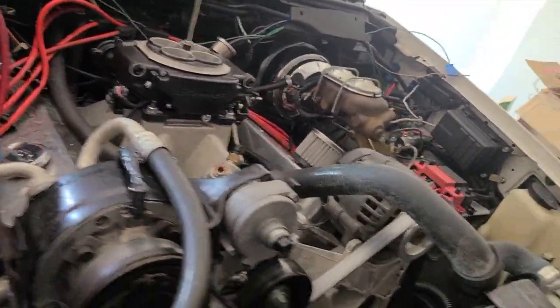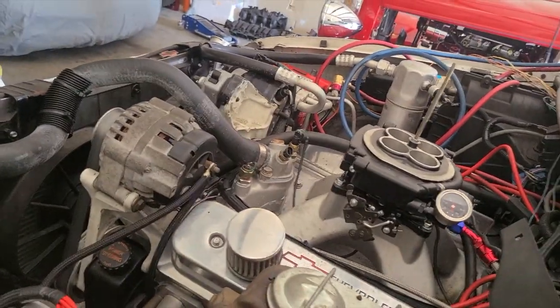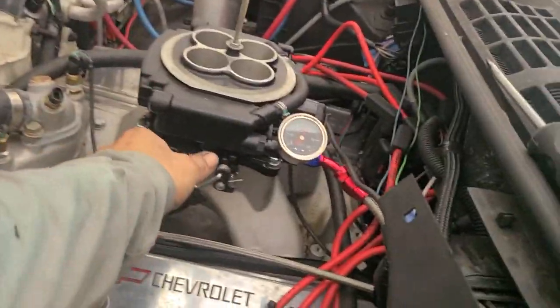This noise on this side is hard to tell if it's a loose rocker, or if it's just that exhaust leak. Exhaust leaks are a nightmare. I don't hear anything if I put a screwdriver to the valve cover and put my ear on it. I don't necessarily hear anything. Might have been a dry lifter, but yeah, it's not doing the kind of bumpy idle thing that it was doing with trying to find itself.